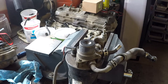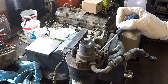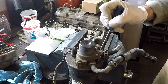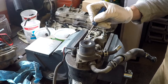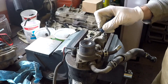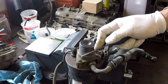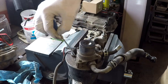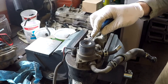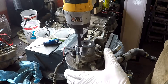Here's a video on how to rebuild a fuel filter head on a Duramax diesel. There are three screws which are Torx bits, size T20. Take an o-ring pick and clean out any gunk that is in the actual head of the screw, because these Torx bits like to strip. Just clean it out as best as you can, then take the Torx bit and put it into the socket.